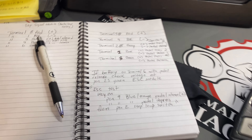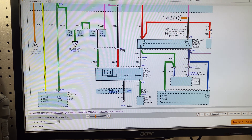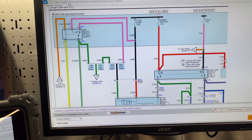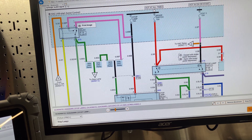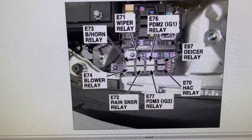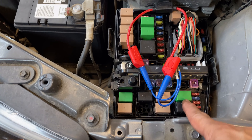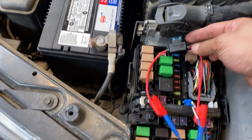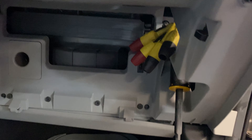I'm making some notes to make things a bit faster — it's hard to decipher information from Kia sometimes, even though the diagrams are really good and have hyperlinks. For example, this HAC — Hill Assist Control / Hill Start Assist — is part of the system equation. If you click the link it shows the connector location with a color picture; it should be in the right corner of the engine bay, and it is. So we have that relay here in the corner next to the fuses. I've put in a jumper instead of the fuse, and I want to put an amp clamp in here.